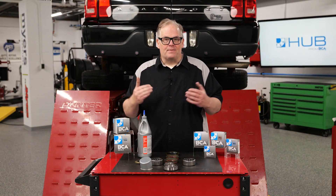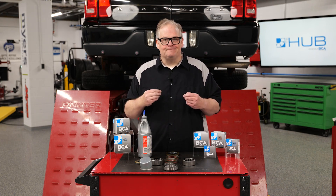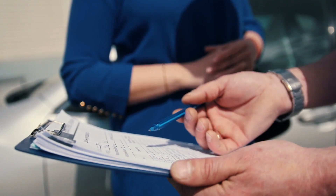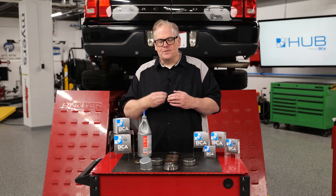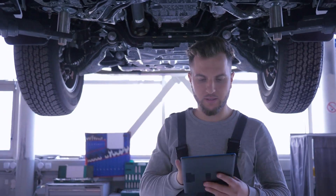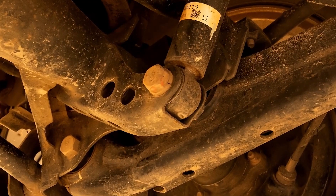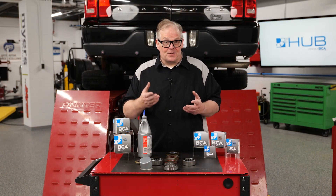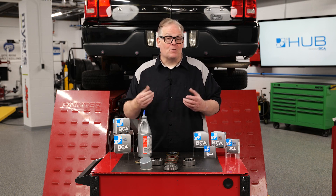Inspection of the bearings of a solid axle is just like any wheel bearing. First, start with the customer complaint — some complaints may sound like a brake problem or even a drivetrain problem, so get all the details about the symptom. Second, perform a visual inspection of the axle. Any signs of a significant leak may indicate the unit has been run without lubricant. Look at the ends of the axle as well as the center section. Shiny leaks are the sign of an active leak; dull or matted finish leaks might be normal seepage or weepage.